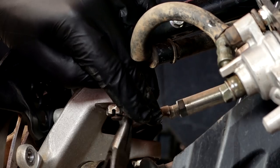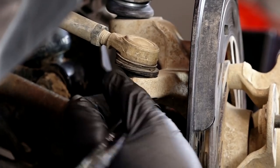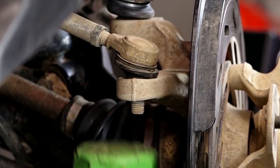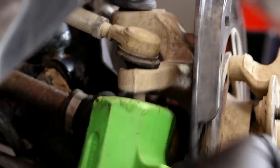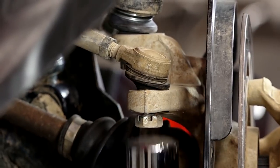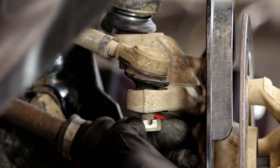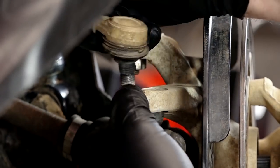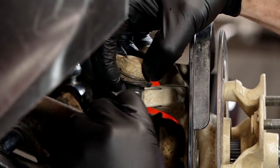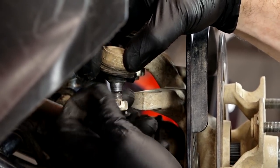We're going to take off our steering arm and upper control arm, but there's a couple of cotter pins we have to get out first. Go ahead and get the steering arm first. We need to use a dead blow hammer on that because a regular hammer is going to damage the threads. What I did is took the castle nut and just put it on backwards, and there was just enough of a gap to where I could hit it with a metal hammer, and that was enough of a shock to get it out of there.